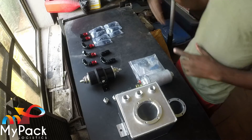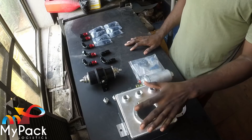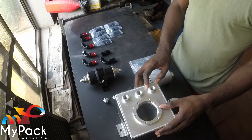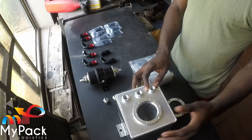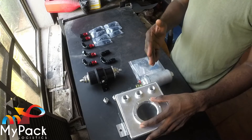When we did this setup there are some things that we had missed out. One was the fuel filter and the next was a surge tank. The surge tank is essential to preventing fuel surge.